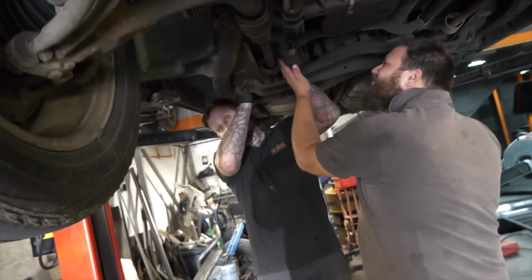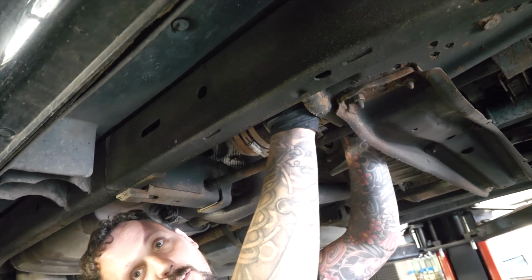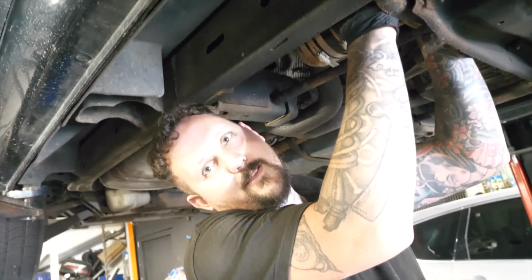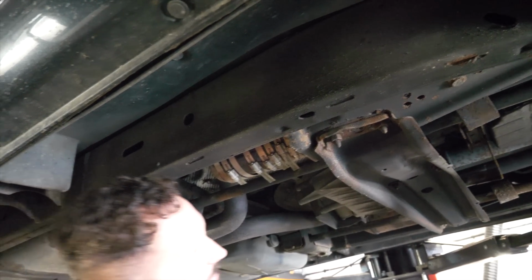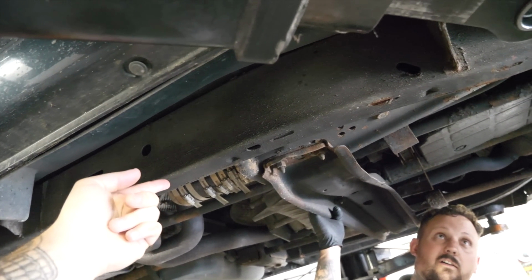So we've started the ML up to see where the blow is coming from, and are we saying it's not coming from where the Jubilee clips are? It's coming from that horrendous... Is it really? Yeah. Funnily enough, it's coming from where the multiple Jubilee clips have been put on one of the banks of cats that side. Oh yeah, there it is. Okay, that's perfect. So the first thing is it needs another cat, or that one cat changing.